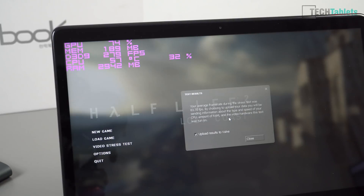An impressive result — I've got 83 frames per second in the Half-Life Lost Coast video stress test, which you can get off Steam for free. Max temperatures are about 58 to 60 degrees. The same exact test when I did it with a 10-watt power limit and no copper heatsink mod reached 93 degrees — the difference is absolutely massive. When you do these mods and unlock the power limit, you can almost double the frame rate: before I got about 58 fps and now it's about 83.